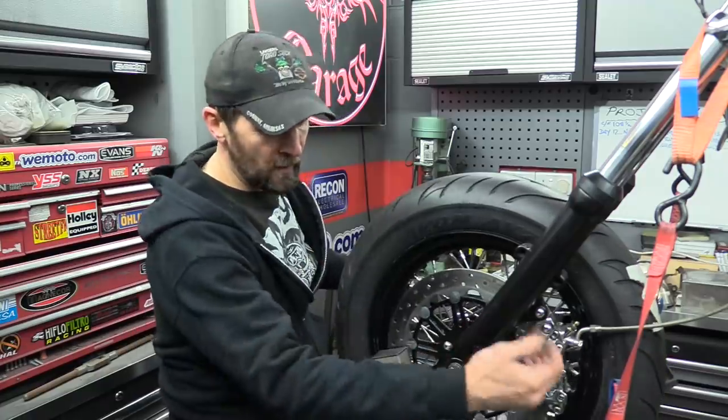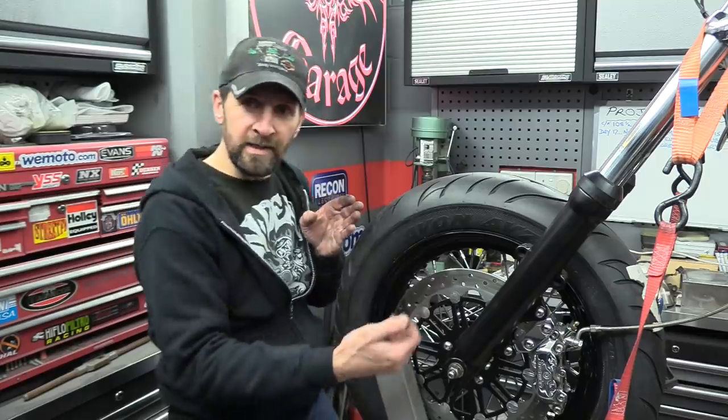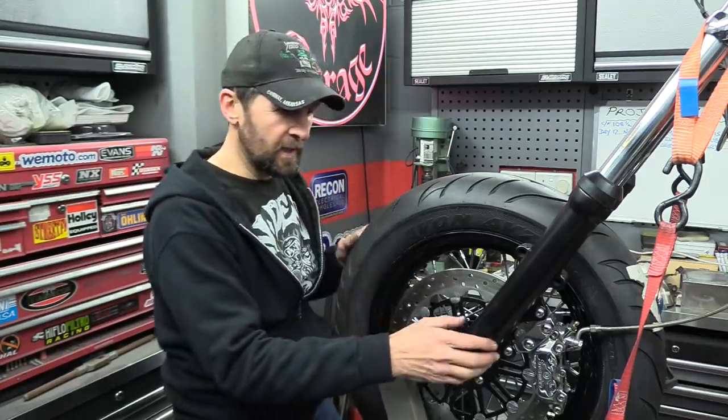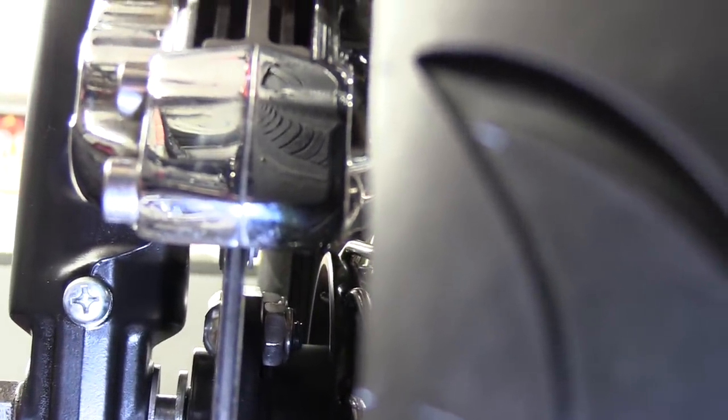Now let's visually check what it looks like underneath, which is the only visual vantage point that I've got to see if that disc is lined up perfectly with the caliper. Right, bringing you in close as I can. Grab that shot there. That's the disc, caliper. Caliper comes in two halves, and this is the join between those two halves. And if you just check, the disc there is perfectly aligned with the join in the two halves of the caliper, meaning the disc is sitting right in the middle of the caliper.